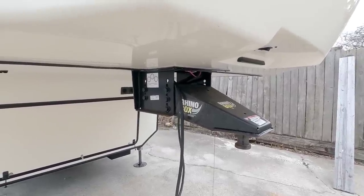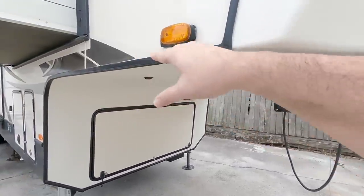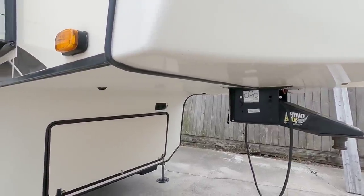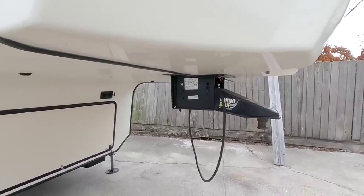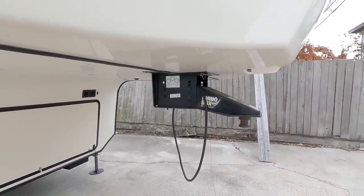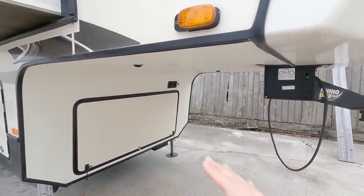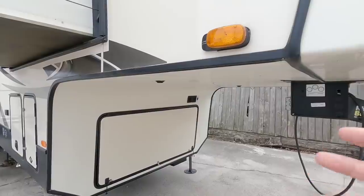In front of me you're looking at the new Rhino box. This is actually attached to an RV with the new Rhino frame. Basically the difference is this deck right here, this overhang. On the older version they had some I-beam structures that wrapped around the front with reinforced bracing. On this newer one everything's been significantly reinforced and they've moved to a six-by-six boxed beam that runs across the front. It's supposed to be significantly stronger and more rigid than any previous design, and that changes how the pin box can attach. The logic and engineering is pretty much the same: to minimize stress on this overhang area, because overstressing it can lead to frame or metal fatigue and possible frame failures.